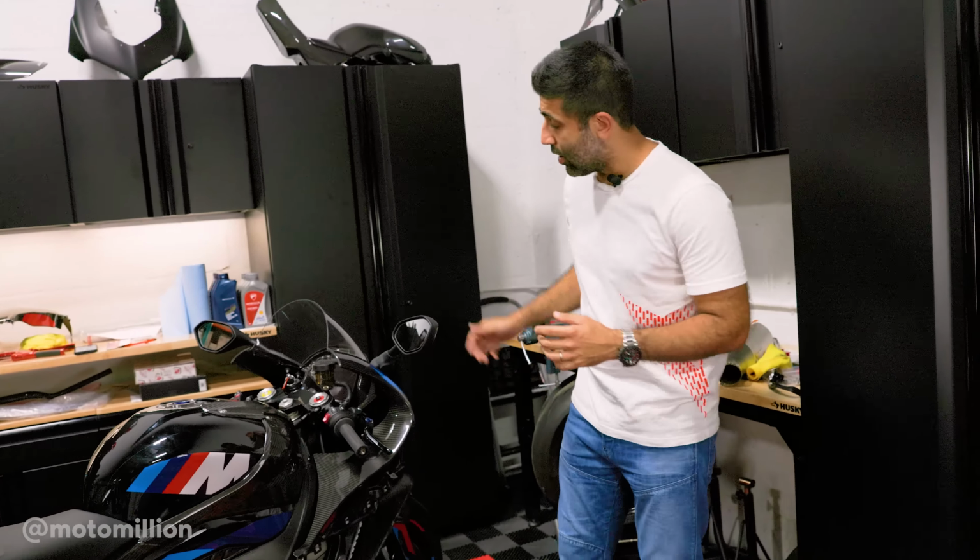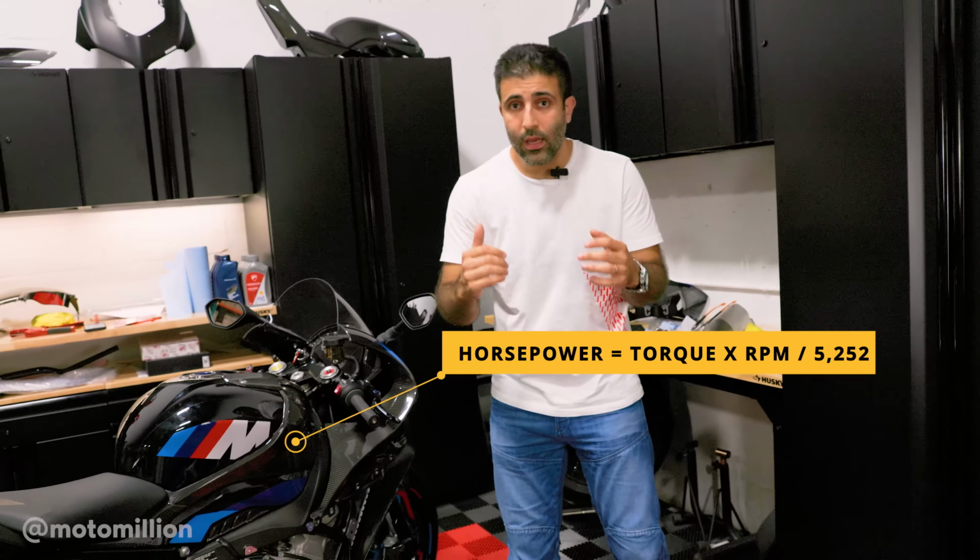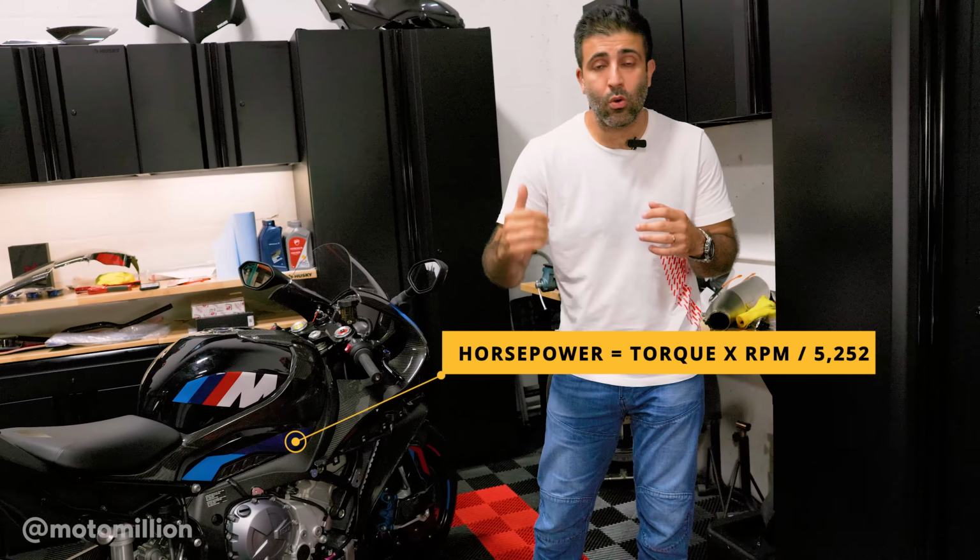I don't want to bore you guys to death, but just think about it. If you have one variable and one constant, the only thing that's going to change is your variable. You know that you've recorded that change. And what does a constant mean? Constant means something that is like a measure that is perfect, right? So you go on a scale, and if it's reading correctly, it's always going to read the same thing when you step on it. So going back to the horsepower thing, you want the constant to be your RPM, because as I said, horsepower equals torque times RPM divided by 5,252.